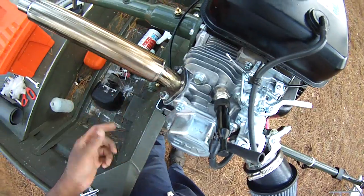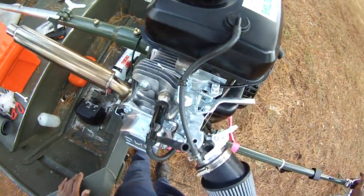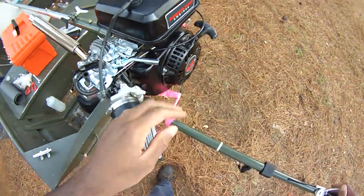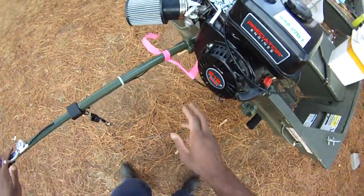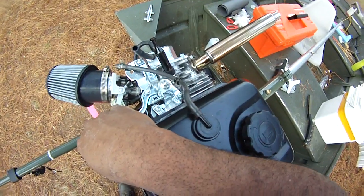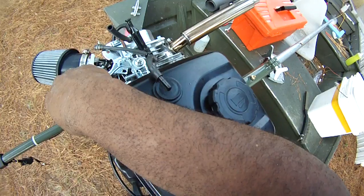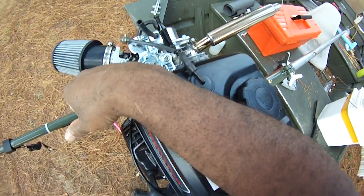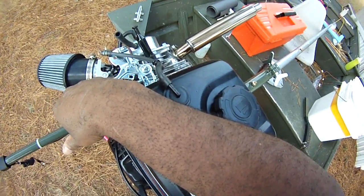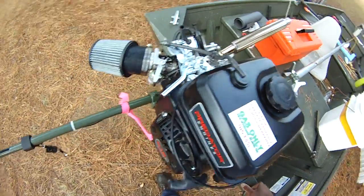Yeah, there's the gasket. It's doing alright. The new, man, that thing pumps a lot of gas out of there. Golly. She's not ready to go yet. We'll give her a little choke. I found with these motors, you got to give them a little bit more choke. All right. Yeah, that was the governor kicking in there.